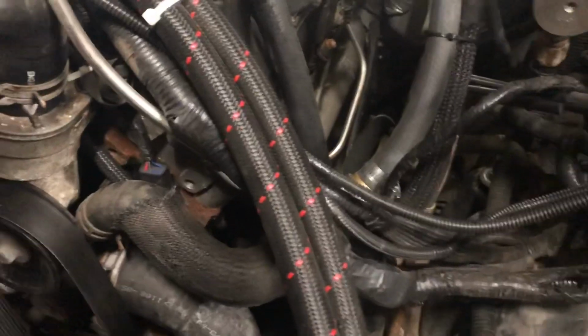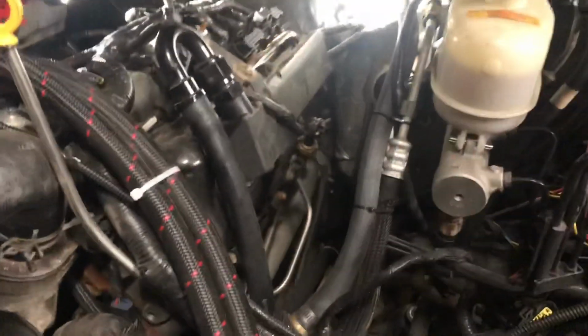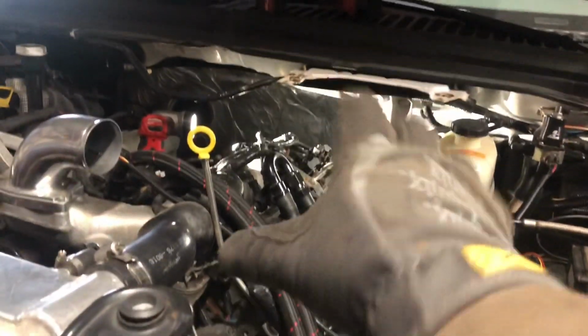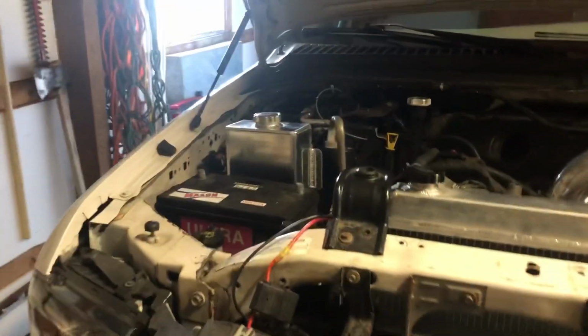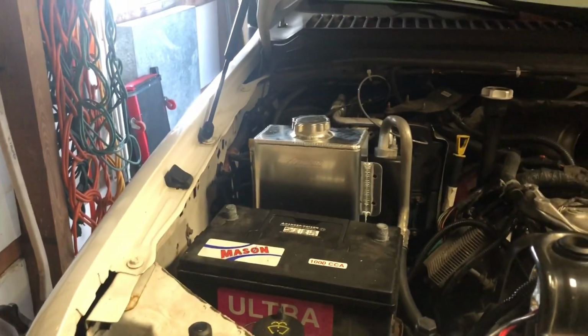It comes around. We got it close to the power steering line. Then it goes into our other line here, which goes to our front cover. So that should still allow us to have good heat, but now we have eliminated the degas bottle. Good to go. All right, so moving to what I'm thinking, or how I want to mount this overflow / expansion tank deal.